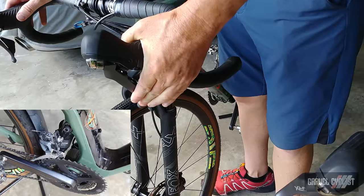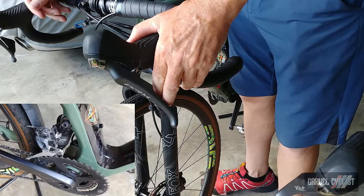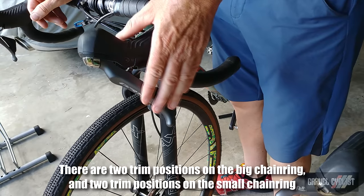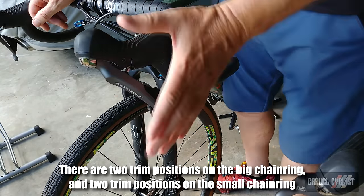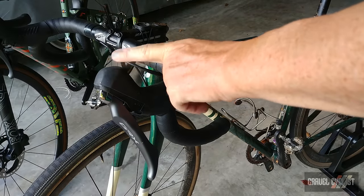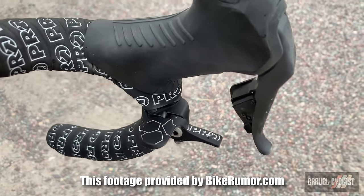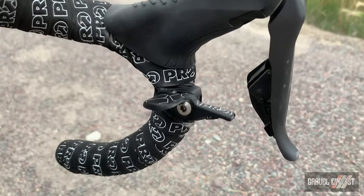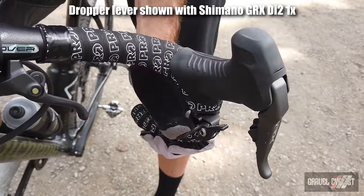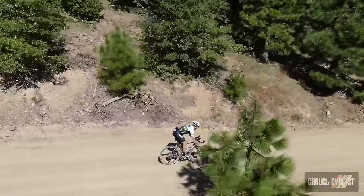Shifting with the 2x is effortless. Right now the bike's on the small chainring — one click will put the derailleur onto the big chainring. One click on the small lever will drop the front derailleur to trim position number one, and then another click drops it down to the small chainring. There's more effort involved than using Shimano GRX Di2, which will spoil you, but this is still very good stuff. When tuned, it's perfect. For the 1x shifter setup, the left brake lever is just a brake lever. There is dropper seatpost support, but Shimano uses a dropper post lever installed onto the drops rather than actuating from the left shifter.